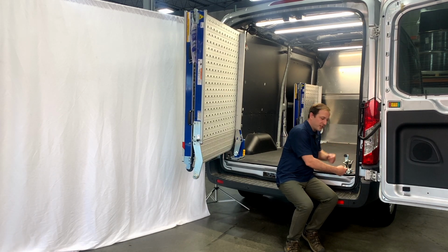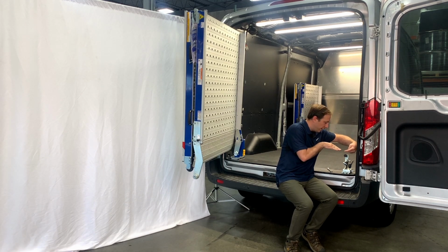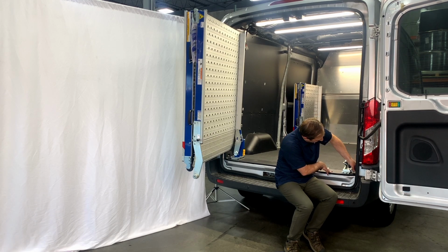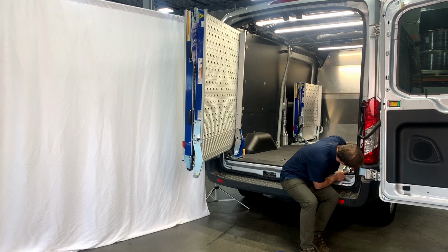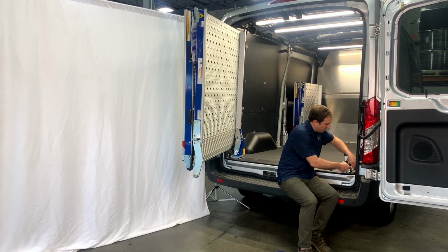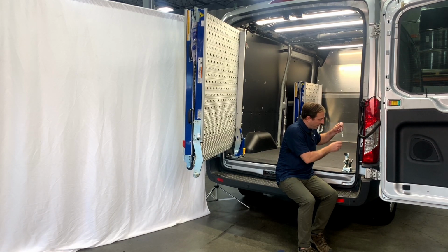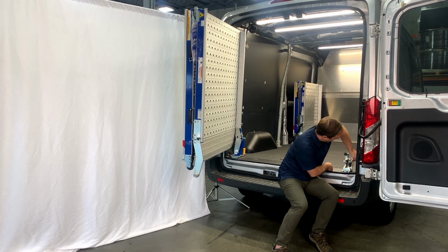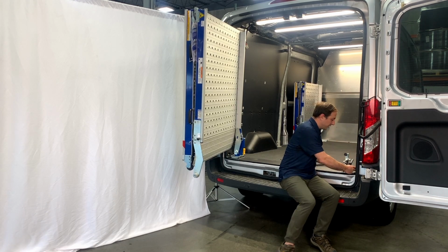And what this bolt does is it comes through and gives us positive contact for when this lock is coming in. And so if you back the nut back most of the way and then start threading this bolt in gently, you can look and see inside here where it's going to make contact. And the moment it hits the plate for the lock, it's going to stop. And what you're going to do is spin that nut back, put your 13mm wrench on it, and using that nut, make it a locking nut, tighten against it, and now this limit will not move.